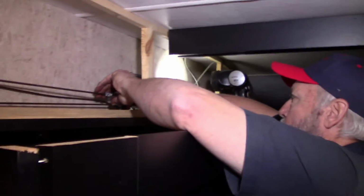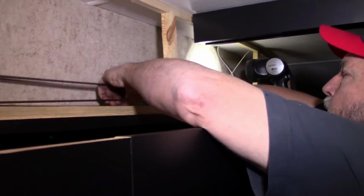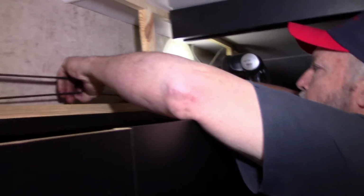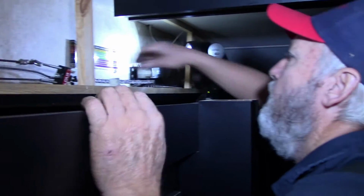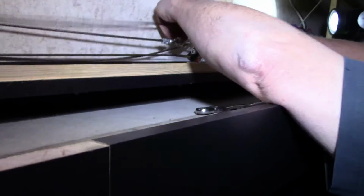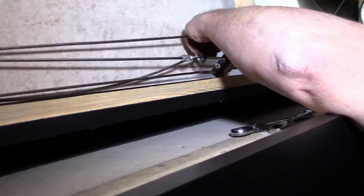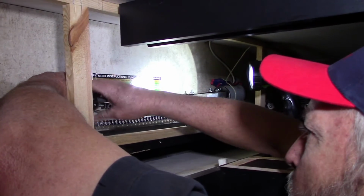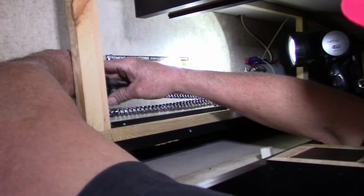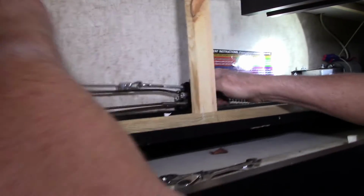Just put that eye bolt back in there. Put your little adjusting nut on it. Now we are ready to start adjusting this room, which I think is severely out of adjustment. I don't know why this side is so loose. Unless it's got stretched. Because these black brackets here where the eye bolts go in actually pass each other here, and there's not a lot of clearance. I think because the cable's been broke for a while, the customer kept using it.